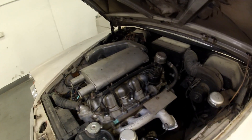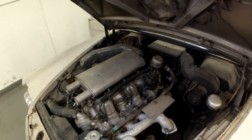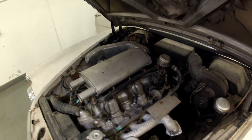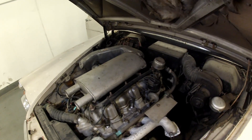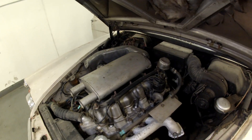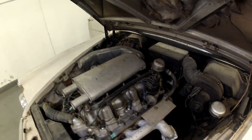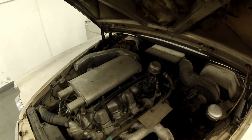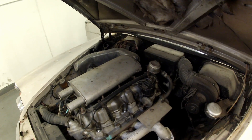This one is the Rover P5 3.0. This engine came out just after the Second World War in the Rover P3, starting at a 2.1 litre engine, with various capacities right up to this 3.0 litre version as found in the P5. The most well-known one was probably the 2.6 found in the P4 as well as various Land Rover models, which were produced right up until the 80s.